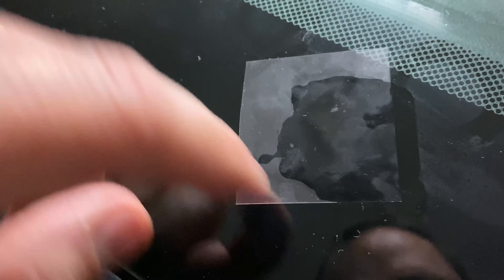I just took off the suction cup from the second crack and I'm impressed — this looks really good. I'm going to wipe it down and clean it up. Now I'm going to put in some more drops — it's drying out — and use one of these film strips like I did for the other crack. Just spread it around a little, get it all over. Don't apply too much pressure on this step because you could damage it more — just let it soak in on its own.